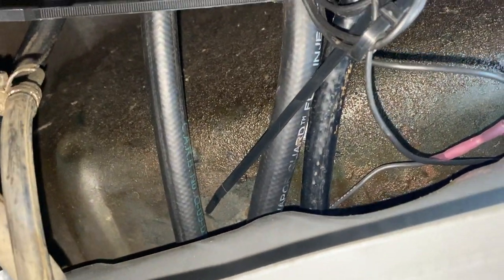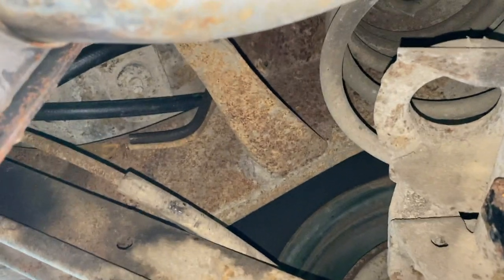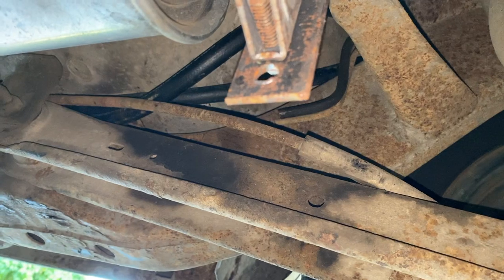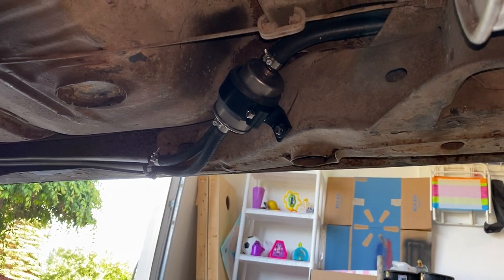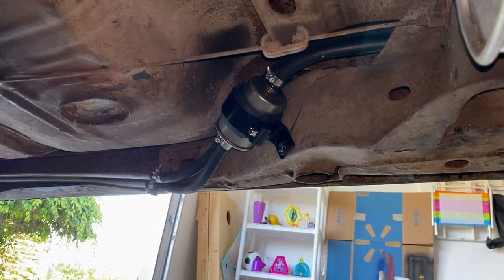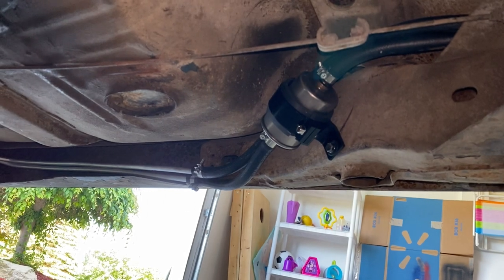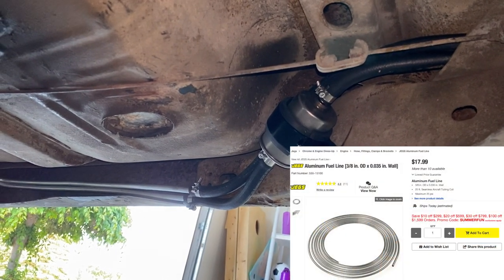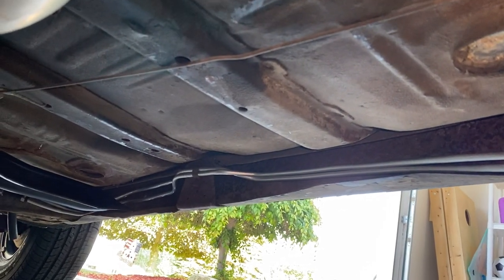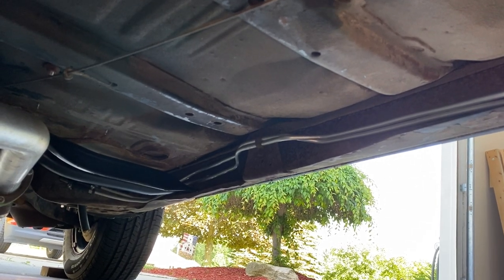When running the lines, I tried to run them similar to the stock OEM lines, which go up into the chassis right over here and make their way past the axle up front — two lines tucked up in there. It's very nice having the Vapor Guard stuff because it's all flexible and you can run it how you want. On the side, while the fuel pump does have a sock on the bottom, it's recommended to run a fuel filter. I have one mounted to the side of the frame, with a flexible line connecting into a hard line. I ran brand new hard lines on the side all the way up to the front because it's cheaper than the Vapor Guard system, and these are just straight runs which makes it real simple.